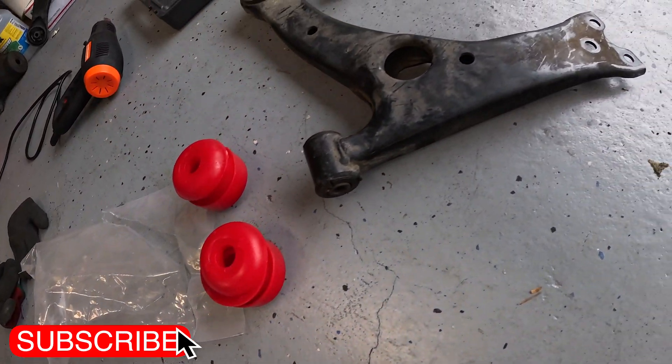Alright guys, I finally got them in. Here's how I got these in without a press: there's an orientation arrow on the bushing and you want that arrow to go towards the front of the car. The instructions say take your horizontal race and that arrow should line up right against it. I got some washers and a threaded rod — the washers fit over the top of the bushing — and the idea is you can sandwich everything together. I was able to sandwich it down and also motivate it with some c-clamps.